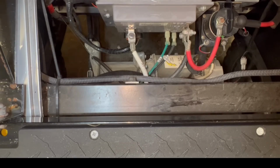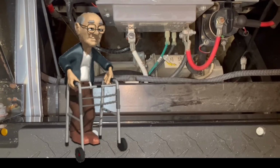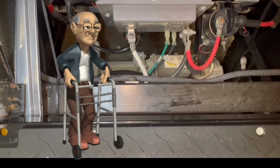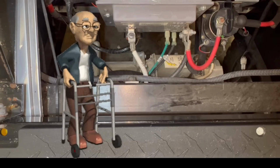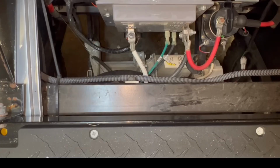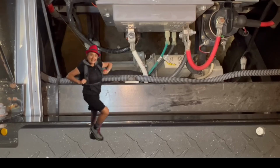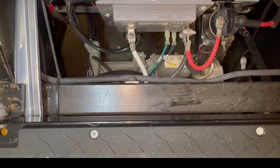All right. So once you turn the key on and wake it up, that's like you in the morning drinking a cup of coffee. When you wake up, then you have to hit the throttle sensor, which is like you got to get up and you got to start moving in the morning. All right. Once you start moving, the farther you go down with the gas, or the farther you walk, the closer you get to work. Same thing with this. When you hit the gas, the farther you go down with the gas pedal, the faster you go. All right. If you don't have no throttle sensor, or if you do your throttle sensor test and the voltage is higher than what it showed at the beginning, the golf cart shuts down for high pedal disable.